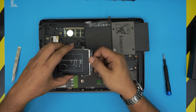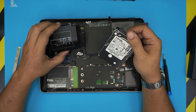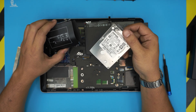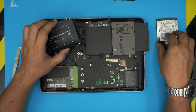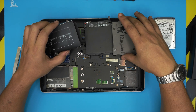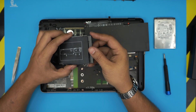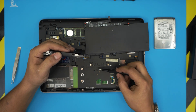Once you remove the screws, slide out the hard drive. This is a Toshiba 7200 RPM 500 gigabyte drive. You can use it as an external hard drive — I'll leave a link in the description for caddies to convert it to USB. Grab the new SSD, align it all the way in, and place the screws for it.